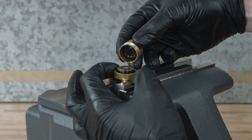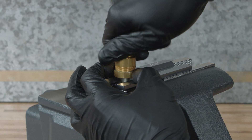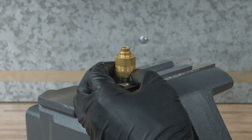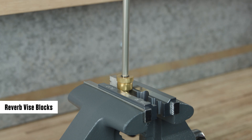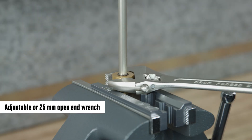Install a new buttercups bumper into the lower buttercups housing, wide end first. Position the lower buttercups housing and bumper onto the buttercups end plate. Slide the upper buttercups housing and bushing assembly up and thread it onto the lower buttercups housing finger tight. Remove the air shaft from the vise and vise blocks. Clamp the lower buttercups housing into a vise with Reverb vise blocks on the wrench flats, air spring piston oriented upward, and tighten the upper buttercups housing onto the lower housing.